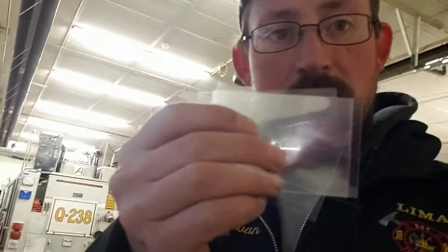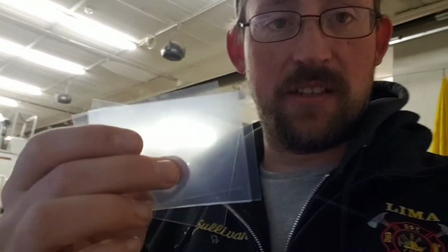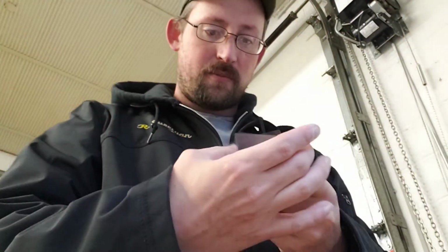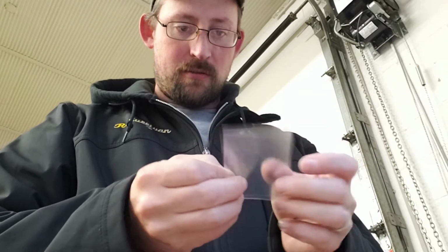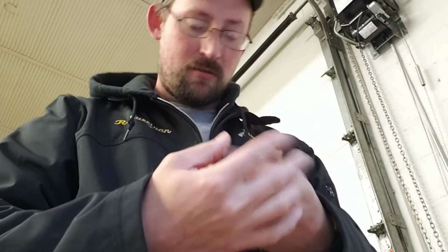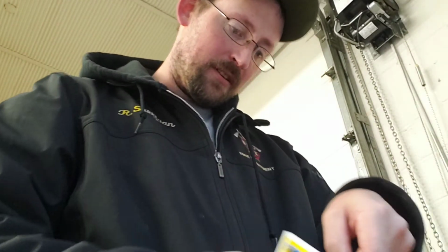These are your curing strips. They look like little Fresnel lenses, but they're not. They're just little pieces of plastic that after you do the resin in the crack, the chip, the whatever, I think they called it a bullseye was the other one, what a BB does to a piece of glass. After you do that, you put these curing strips over the top. And they're very, very clean. So then you let that sit for 5 to 10 minutes.